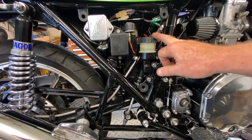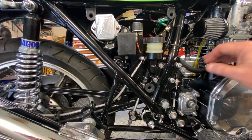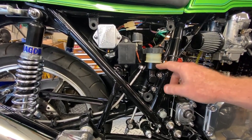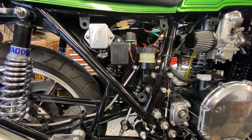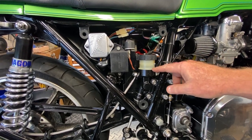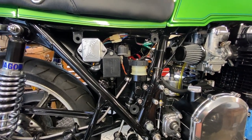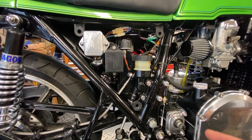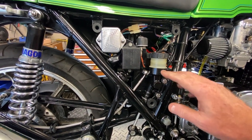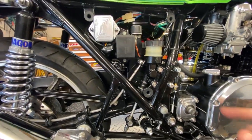Here's my constant battle with the rear brake on this Z1R. The rear brake master in particular — this thing has been painted about four times because of leaks, particularly around the O-ring where the reservoir seats in. I've solved that by obtaining a set of two O-rings; the seller only sells them in pairs and they're unobtainium elsewhere. I've had so many problems with this thing, but the brake works — it stops. The trouble is it's leaking again.